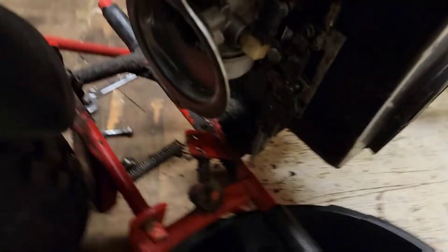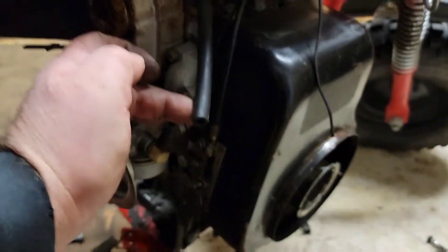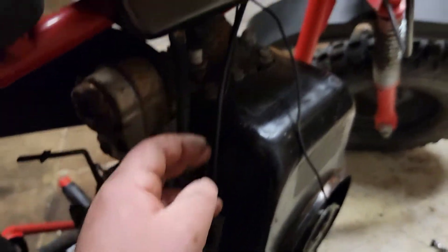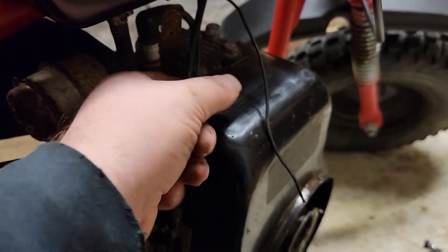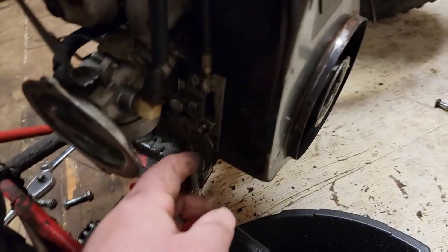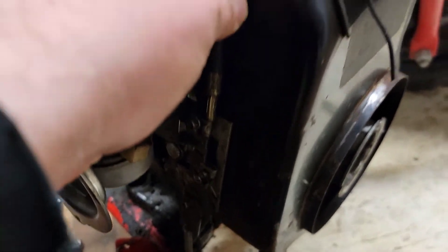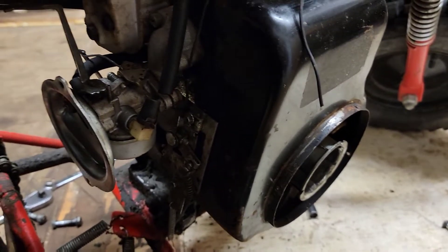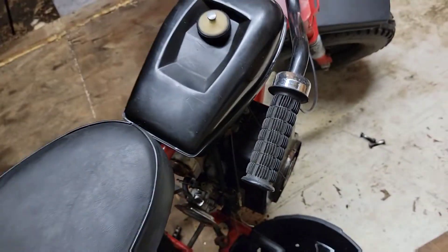Now on to the other side. Actually, before you take out your bolts or your motor mounts, you want to disconnect your gas line — mine is all dry rotted so I just snipped it. Kill switch wires — this one has two of them — runs up to the switch. And then your throttle cable linkage, you want to disassemble this. I loosened them up and they should just pull apart. And there you go — that's everything off the motor so I can slide it out of the frame and get it ready for the new motor.